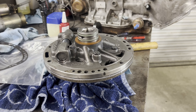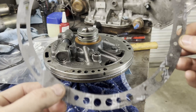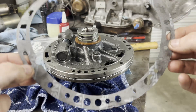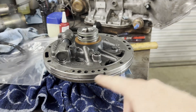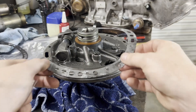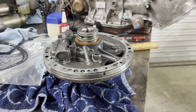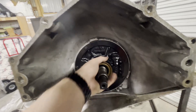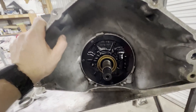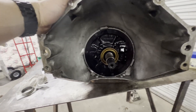We're caught back up. I got my front seal in. We're going to put our gasket — typically the writing faces up; it doesn't have any instructions so I'm not sure if it matters, but just make sure you align all these holes up with all the holes. Don't forget your new washers on your pump bolts. We've got the pump in, got it all torqued down, and it's ready to go back in the S10 so we can start making more content — like putting the crossmember back under it.